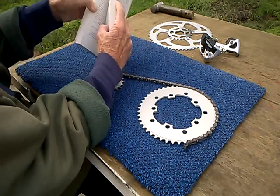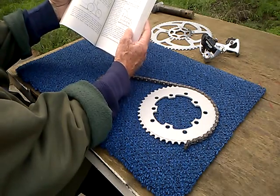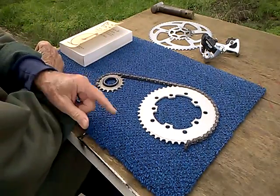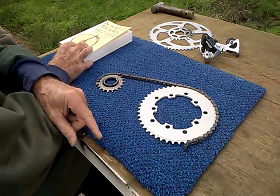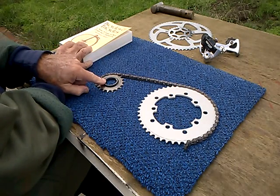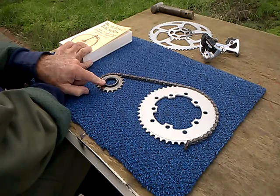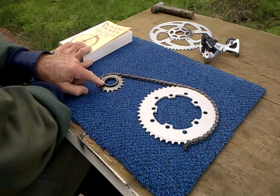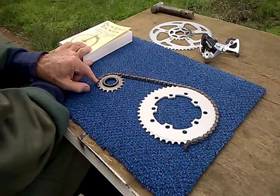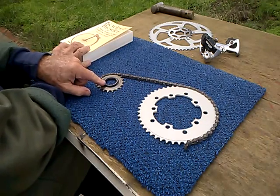He uses mathematical functions, differential equations, curves, analysis, statics, dynamics, aerodynamics. But we're going to zoom in on just what he has to say about cog sizes. He very early established the fact that the smallest cog that's of any practical value for a bicycle would be 14 teeth. That was his lower limit. Below that number of teeth, the inefficiency starts mounting. Above that, we're talking just, you know, in the upper 90s in percent efficiency. Below that, we're dropping rapidly towards 90% efficiency.